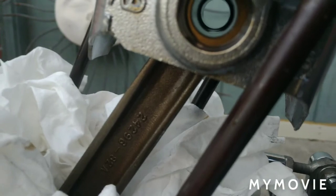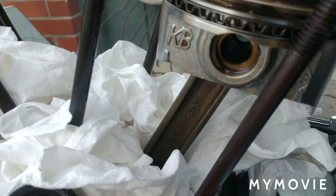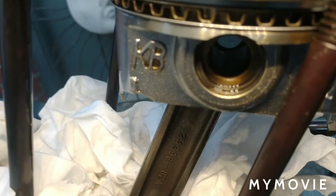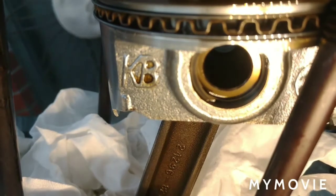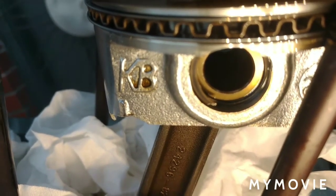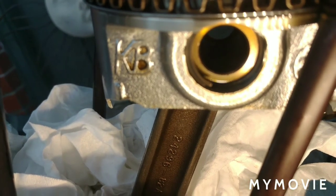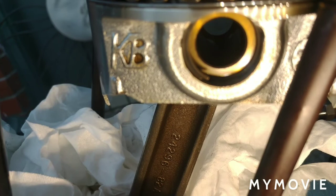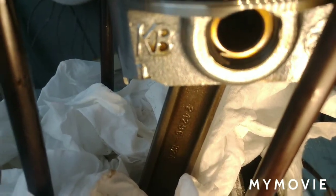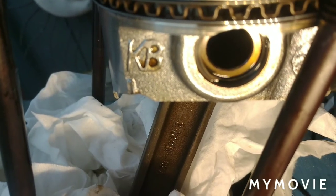So it's a good thing that we're in here — that the head gasket blew when it did. I don't know if you can see, let me get a flashlight. So that retainer clip is not all the way in; it's actually working its way out. If that retainer clip came out, it would have been catastrophic damage to my front cylinder — all bad. Because that would have moved the wrist pin out and it would have been scraping, just chewing up my front cylinder. I would have had a catastrophic failure. Lucked out on this one.